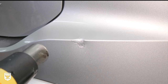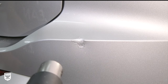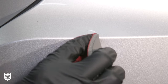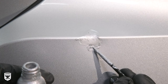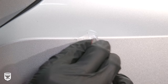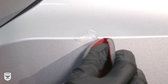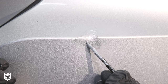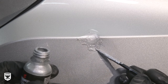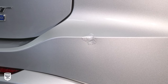After round one, it certainly looked much better than a scuffed black bumper, but was I proud of my work? No. I could already hear the YouTube commenters in my head. So yes, I agree with you — it looks terrible. I was down, but not out yet. I decided to let the paint dry and then sand or flatten the paint in hopes of a better-looking final product. I would need to continue building up layers of paint again and again by slapping on coats that I would later sand flat. The process of paint, heat, sand was repeated for three complete cycles until my eyeballs started to cross from frustration. After the third cycle, I polished with a Nano 3-inch and Meguiar's 105 to see how much better the blend would be. With an embarrassing amount of time spent on this, all I received was a headache and a few gray hairs. Clearly, the trifecta of touch-up mystery has taken its toll on me.